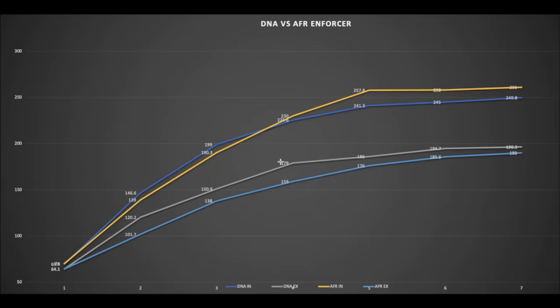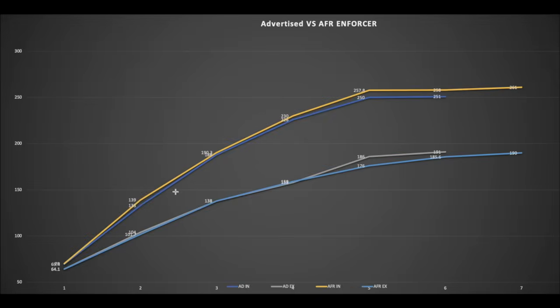I actually thought they were going to be closer. It's curious to see the difference between the advertised flow numbers of the AFR heads versus what they actually flow — I'm going to chart those out and show you guys. AFR advertises versus what I got on the flow bench: very similar for the most part. A little variation in the exhaust down low and a little in the intake up high, but pretty normal. The biggest difference is probably 8 CFM. They actually flowed better than what they advertised, and I find this often happens — most of the time they underestimate a little bit. There is always a little bit of difference head to head and flow bench to flow bench.